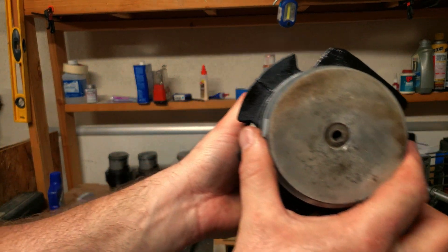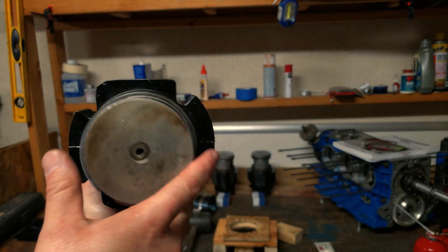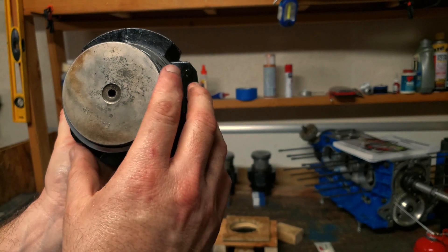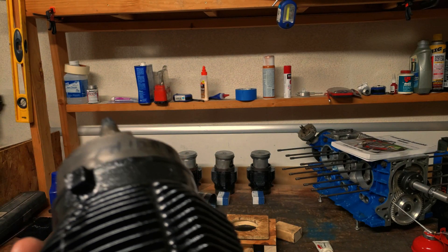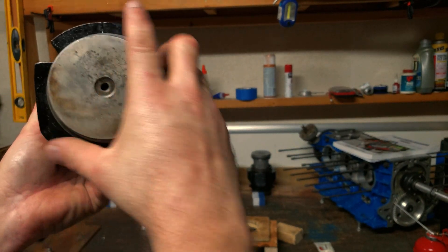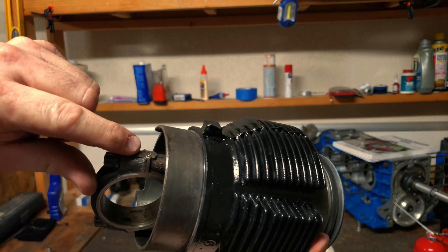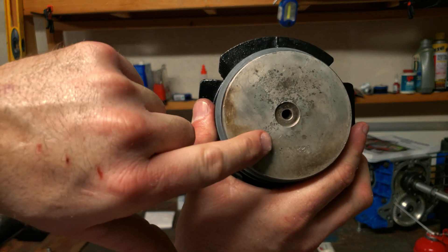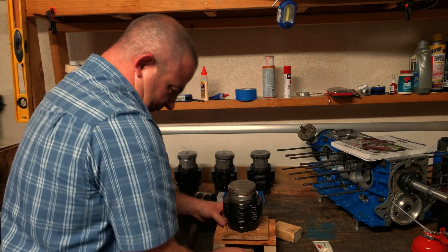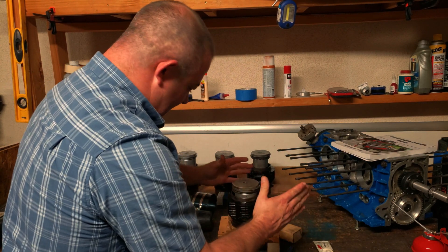You'll see a little arrow right there, and that arrow points to the front of the motor. How you determine the front is this: you'll notice you have a narrow set on the bottom and a wide set on the top. This is for cylinder six — we're on this side of the motor, so this arrow needs to be pointing in that direction. These two are always facing up, arrow to the front. That's how you set this thing up ready to install the pistons. The block is here so I can get this into the correct position.